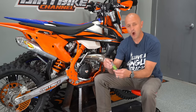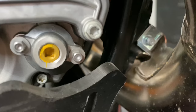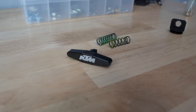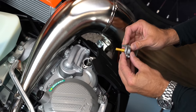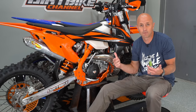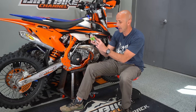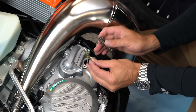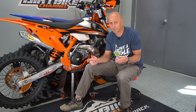So a little bit of a history lesson. On your older KTM bikes, the ones that came with carburetors, you had your power valve adjustment right here that you could adjust. There's a little brass screw right here — I'll roll a picture of this in — and you could get a little square tool to turn that screw. All we're really doing is adding preload or taking preload away from the power valve inside, determining when the power valve is going to come fully open at what RPM. Back in the day, you used to get inside your little kit with jets — a red spring and a green spring. The yellow spring was already in the bike and was the intermediate spring. The red spring was a lighter duty spring, meaning the power valve would come open faster, and the green spring was a heavier duty spring, meaning the power valve would stay closed longer.